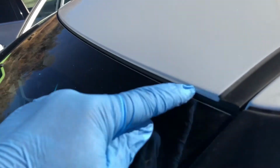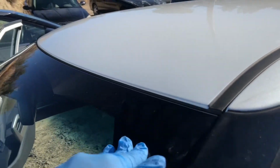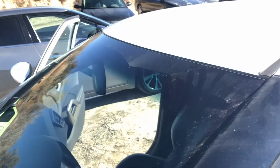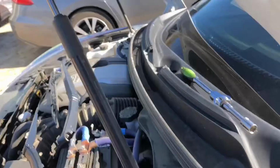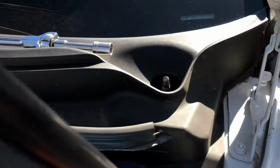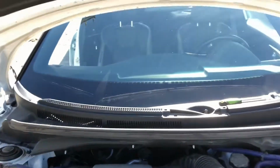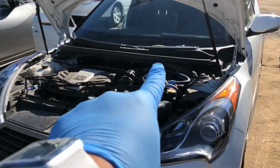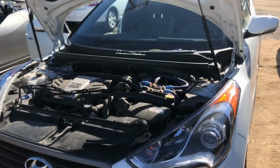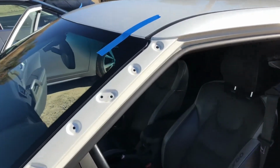And then for the molding, if you are a technician that likes to use universal, you could probably use the PUG7 from Marcy, and that's a pretty simple removal for the cowling. This little clip right there, they're push down clips, and that's it. I'll get this window removed, but the little cover, definitely, if you don't know, the first time you'll break it. All right guys, quick tip on this upper molding.